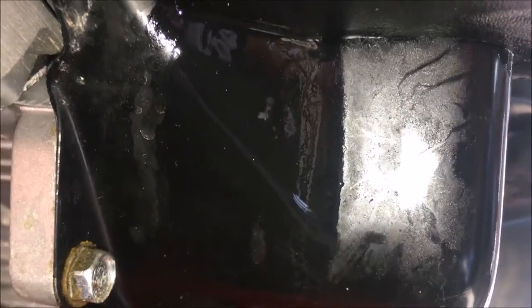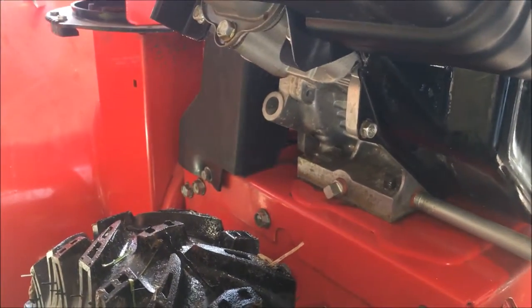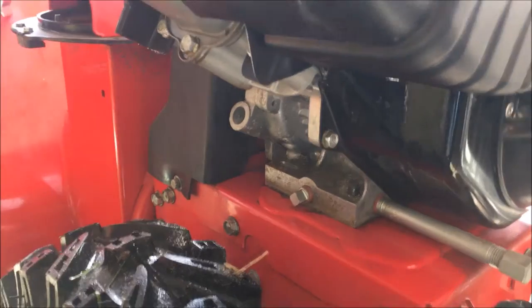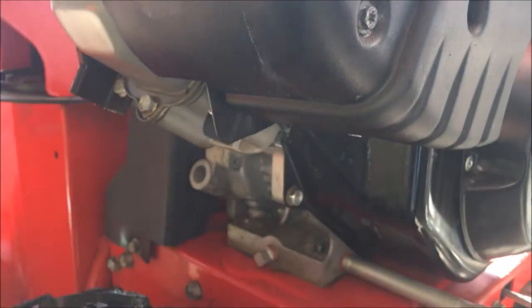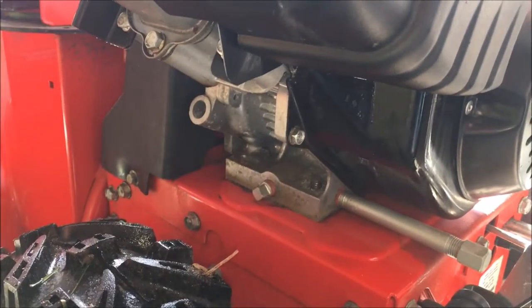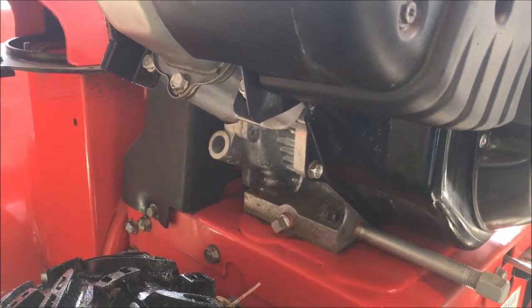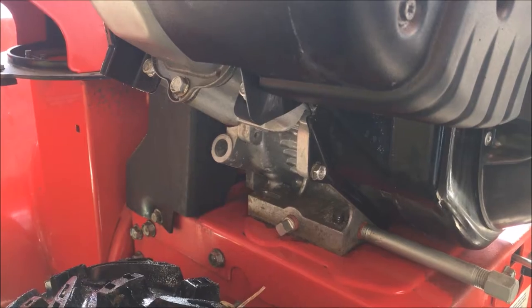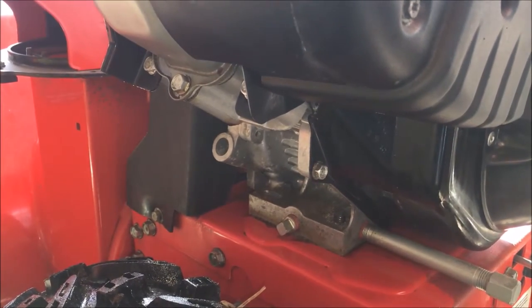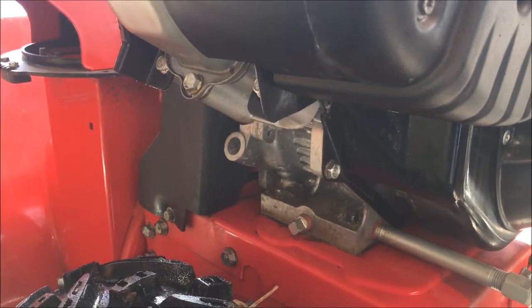See that? It's still flooding over, so I do need to take that needle out and reinspect it. Also, I did not clean the seat off, and it's quite possible some of that white powdery crystal stuff is in the seat. So let me pop that floating needle out, inspect those, clean them if necessary, and I will take a Q-tip to the seat and see if that can't fix it. Otherwise, we might just have to buy a new needle.